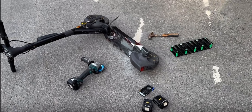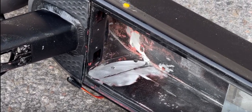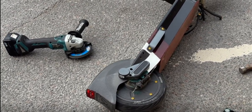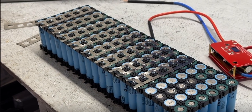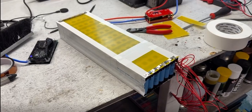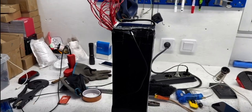After finding my scooter of choice, I didn't even believe this was possible — 6 kilowatts through a scooter that weighs 30 kilos, pushing that kind of power through the original 360-watt motor. I was 100% sure it would blow up. But we do it all in the name of science, so without any hesitation, I started to work on the battery, trying to pack as many cells as I could into the available space.